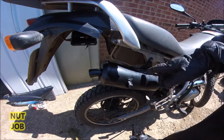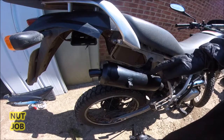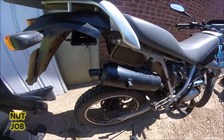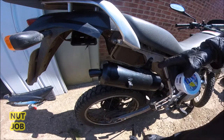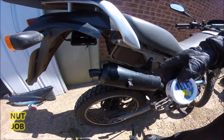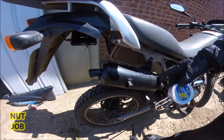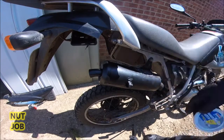What happened was there were still a few little bit of holes in here. So then I ended up having to put on this stuff, which I'll just show you for camera purposes. It was a bit of exhaust putty, which you probably saw me knock off to weld it. So it's all bits of weld, and the arc weld didn't really work too well on this. I think I could have done with a MIG welder actually, which I don't have. So I just cleaned it up and put a bit of exhaust putty in, so that's what I used.